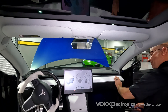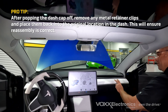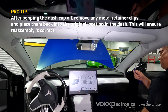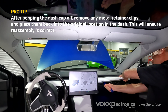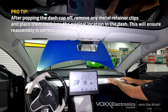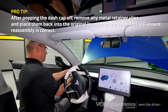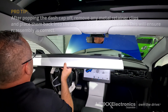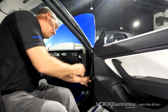This part of the panel removal is a little tricky — it's easy, but a couple of things to note: there are clips underneath in various sections, and in each of the top corners in the back there are clips going down. Treat it with care, take your time, use the appropriate tool, and pull it towards you to release those clips. Once this side is partially removed, move to the other side — slip your tool in, release the clips, pull it forward. Now you've dislodged the whole piece; slowly bring it up and over and set it aside. Remove the rubber gasket and set it back to give access to the kick panel and lower passenger side compartment area — pull it back gently and set it aside.